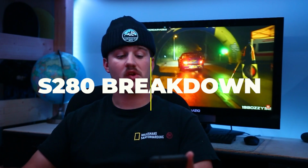Well, basically to get started, you're looking at $1,900 for the kit off of whooshmotorsports.com. So $1,900 basically comes with everything that you'll need. The S280 is interesting because it pretty much bolts right up directly, just like a regular stock turbo would, but it is a bigger turbo in general, hence the fact that you have to shave away some of the block a little bit. There is a tutorial for that that you can find on YouTube. You shave away a little bit of the block to get that S280 to fit up in there. All in all, it's pretty much a direct bolt-in fit.